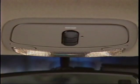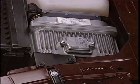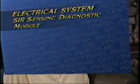The SBM will turn off all interior lights 10 minutes after ignition is turned off. To protect the vehicle during high electrical loading conditions, the rear defog grid or heated seats may be cycled on and off if they are active, and a Class 2 message to the PCM to boost idle speed may be required. The SBM has a programming ability to enable and disable this load management feature.